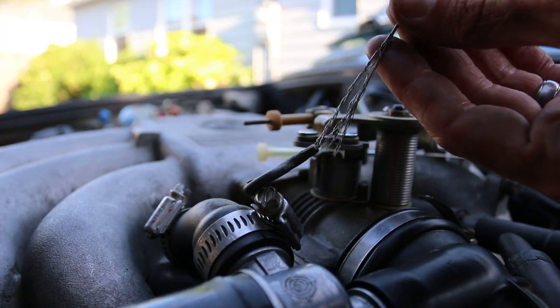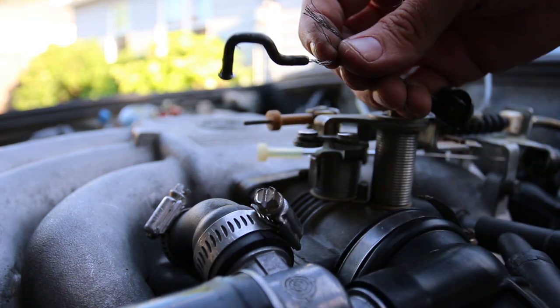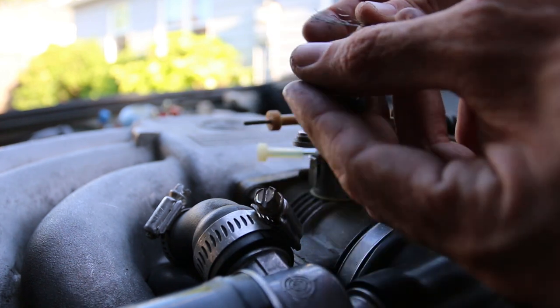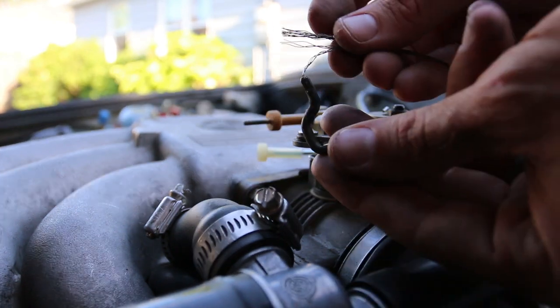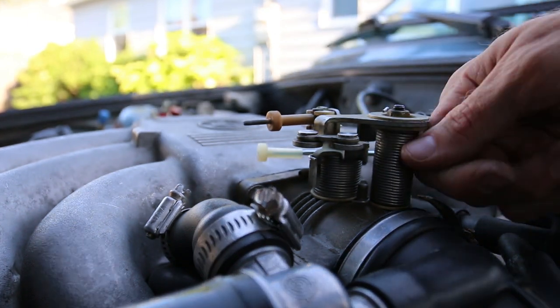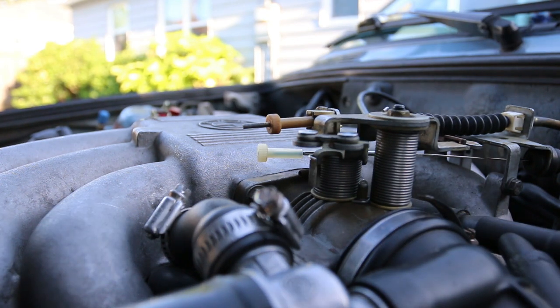This is why I replaced the accelerator cable - I mean that was what I was autocrossing on. Look - I had literally only four threads left out of that entire cable. So yeah, that was a little bit sketchy. I was pretty close to having to just pull a string on here, but didn't have to do that. So let's adjust it properly.